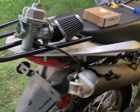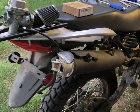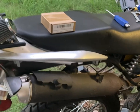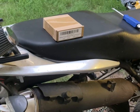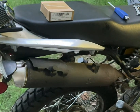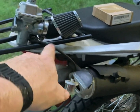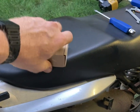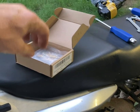Welcome back to another video here on Ghost Rider, which is my TBR7. Just like the link says in the description, we are putting in fatter jets. If you watched my last video — if you haven't, click the end card at the end of this video — we went ahead and did the airbox delete and I put a cone filter. What I was having was issues during mid to wide open throttle: it would bog down and lean out pretty bad.